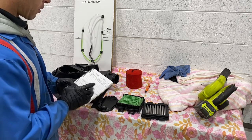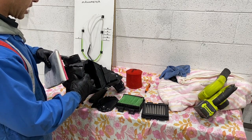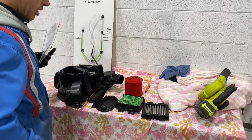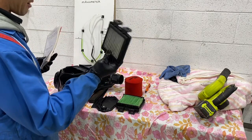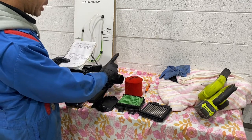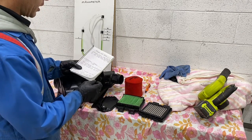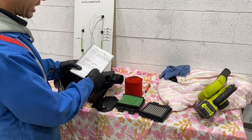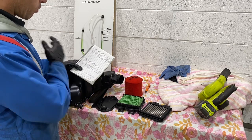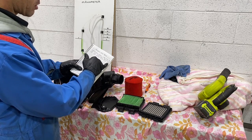Then we went to the modified airbox design. So my full modified airbox had the 4-inch intake. It had the Unifilter over the 4-inch intake as a pre-filter, and it had the Hurricane filter as the air filter inside, and it also had the CB300 modification in the actual top here. It also had the plastic diffuser inside the airbox removed. The full modified setup on high was 25, so it was less restrictive with all of that setup than it was without even an air filter in it. So just not even the boot.